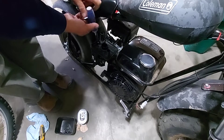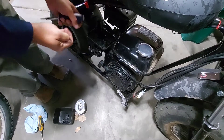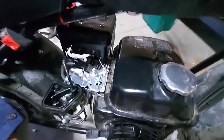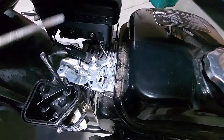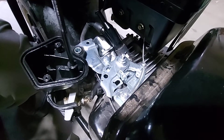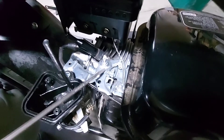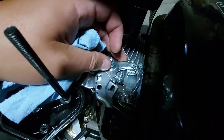What I'm going to show you is not how you remove the governor — everyone calls it a governor, but that's wrong. The governor is actually inside the engine; you'd have to take the entire thing apart off the bike. What we're talking about is what they call the throttle stop screw or the throttle stop. On most of these Coleman engines made after probably 2017, this is your assembly to pull the throttle cable, and this little piece here will move — that's how you get it to go faster.